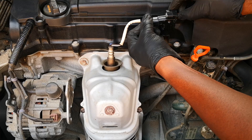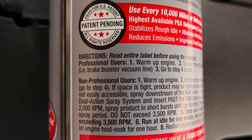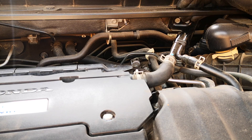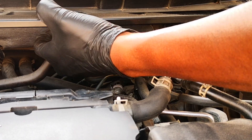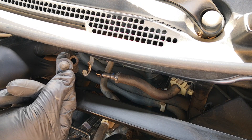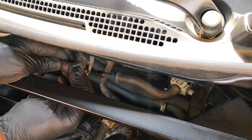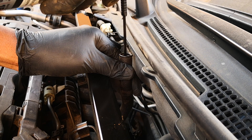I reconnect the oxygen sensor and then we move on to the procedure itself. I'll be doing everything strictly per the instructions on the can. Although you can spray this through the throttle body, I'm choosing to do this through the brake booster line, which is located right here. I found this rubber piece and made a hole on the other side just to form a perfect seal — that's formed a nice seal. I'll just insert that into the hole and we'll start the car.